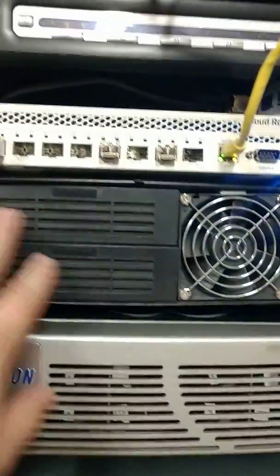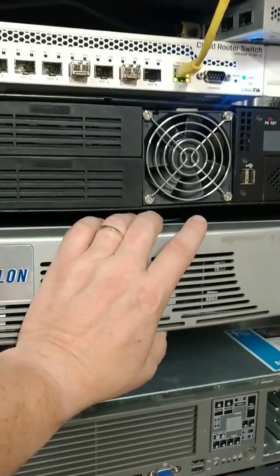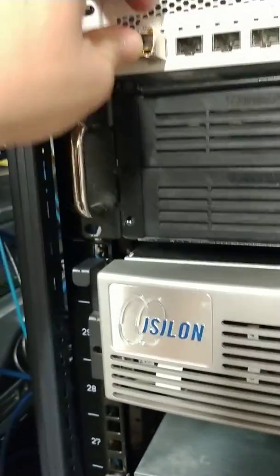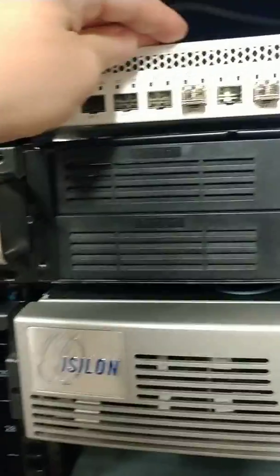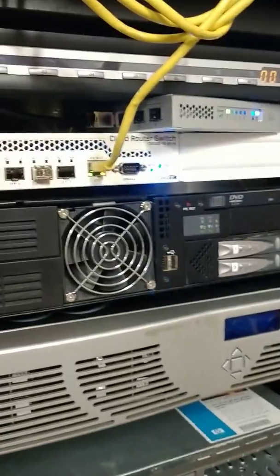For most of the time it's fiber, because they weren't working with copper-based 10 gig cards in that era. By having both worlds met — the RJ45 10 gig solution for the server interface side and fiber optic 850 nanometer style GBICs for your storage platforms — you cover all your connectivity needs. On the four-port switch, you'll notice in the back there are two power outputs, one on the left and one on the right, for redundancy.